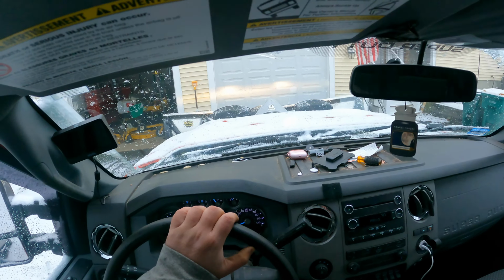Oh, all right, so I got basically no power steering in this truck. Let's roll out the serpentine belt. I'm gonna put some belt dressing on it and see what happens. I doubt it's that. I think the pump's junk, but I guess I gotta be my own advocate. Alright, hopefully that does it. Probably not, but worth a shot.